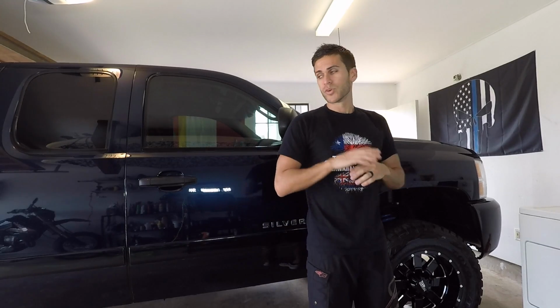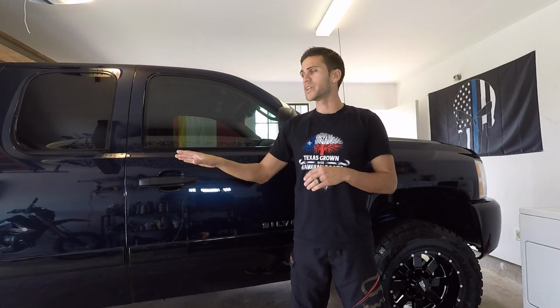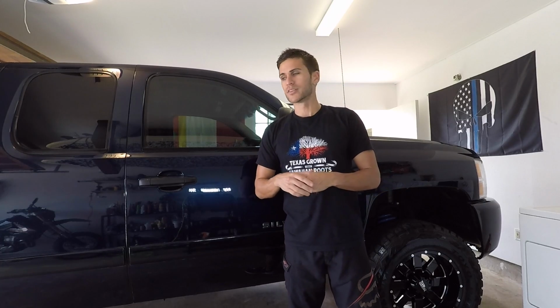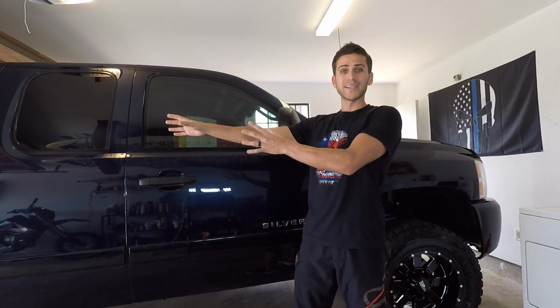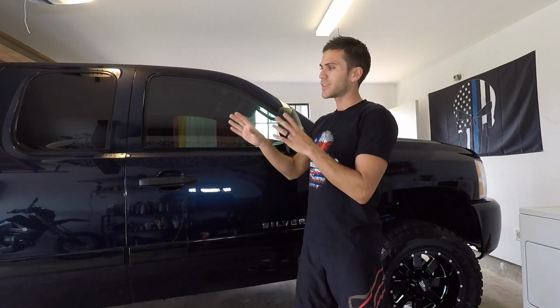They're going to tear up very quickly at that steep angle. The second problem I have with this particular kit, the 2-inch blocks in the rear are built and actually meant to stack, again, stack on top of the rear stock blocks. If you Google stacking rear blocks or anything regarding lifting your truck by stacking blocks in the rear, the internet will take you by storm. Very, very dangerous to do if you think of how the truck operates.